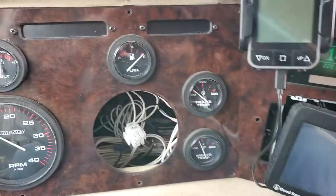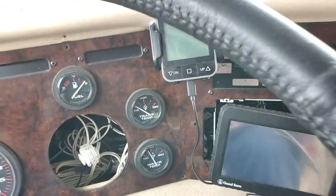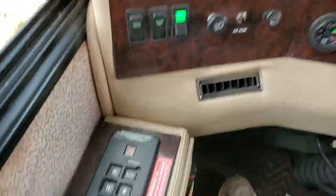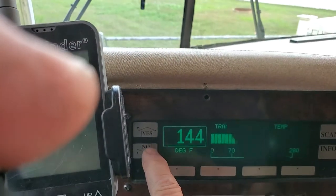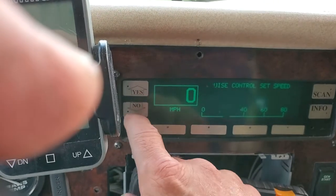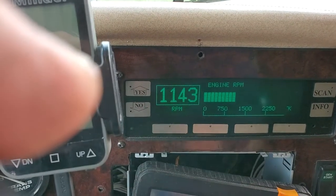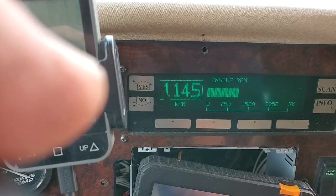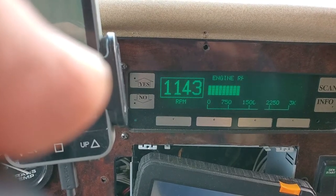You can see it's 142 — there's your manual gauge right here. We're in neutral right now. The RPM is around 1,250. There's the transmission output speed — it's supposed to be zero, that's one of the things in the book. Battery voltage is 13. The engine is at 1,142 RPM. Now this transmission computer might say that's too high — let's find out if it does.